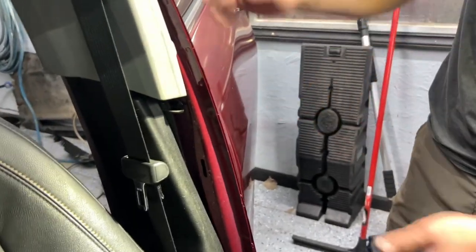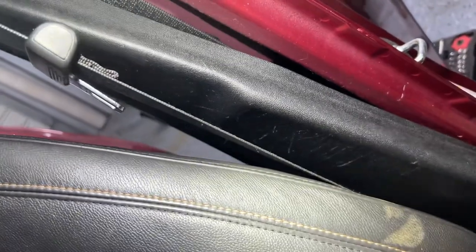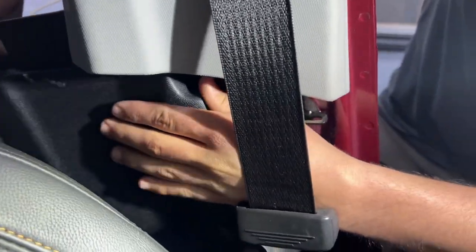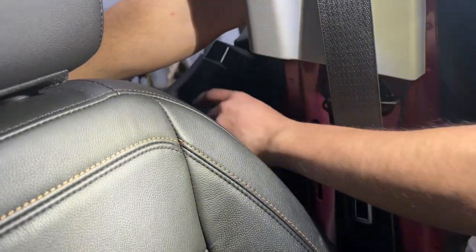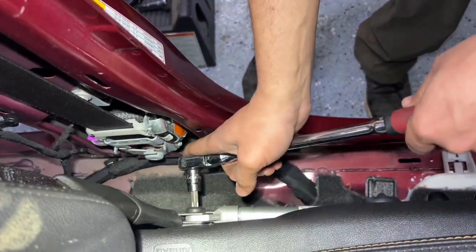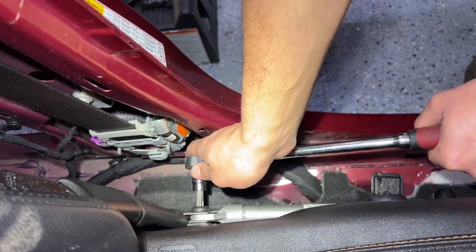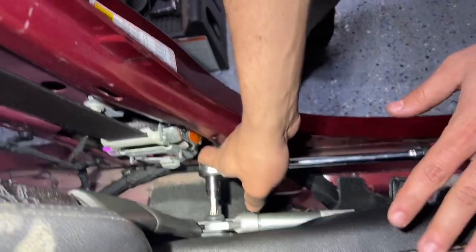I'm pushing from the back and pulling from the front to tilt and remove this panel. The space is tight so it will get scratched a little, but there's no way around it when the seat belt is deployed and tense. We always try to minimize scratches as much as possible. Now that we have the bottom panel off, we have much more clearance and I can get my ratchet in to open the pretensioner bolt, which is a T50 Torx. These usually have thread lock on them, so I would not recommend using a power tool.